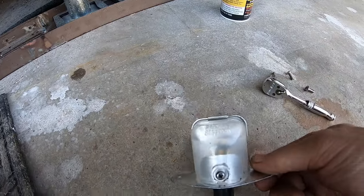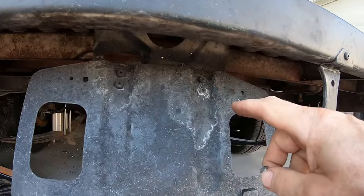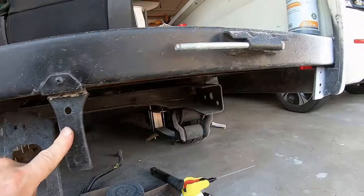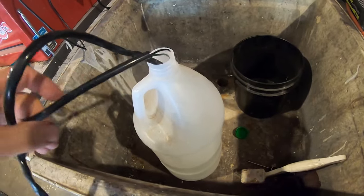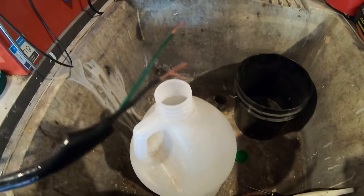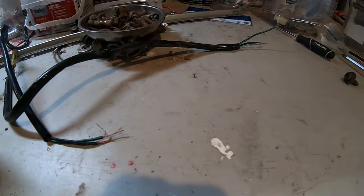Just put in an LED bulb to replace the old bulb — it's newly painted and it works. Even this connector looks terrible. I can't run a tap through these bolts and you can't take this bracket off — it's welded. So I'm just going to run some stainless bolts, the other ones are half rusty. I've ordered some taillights — 520 taillights — so I'm going to have to relocate these. Here are the taillight and marker light harnesses. These wires — they were pretty black. I cut off an inch or so and the copper is still black. So I soaked them in vinegar for a couple hours. Now they are good to go — so much better. Now I can solder on my lights.